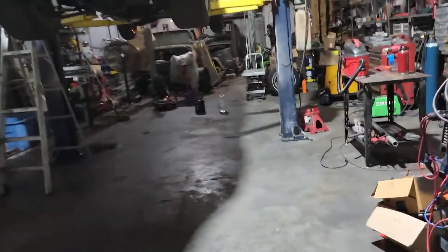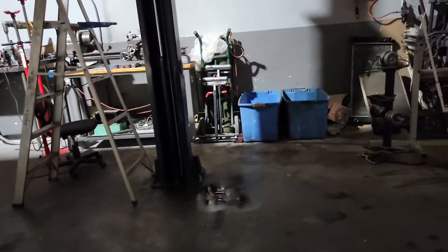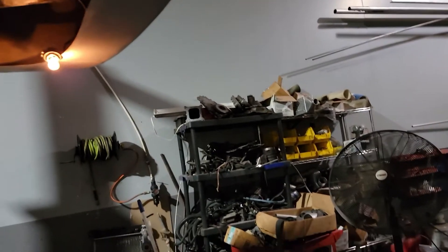Jeff's truck is pretty much done. I've had the radiator draining — it's empty now — so I just have to add the water back in. Oh yeah, that's the side marker light. This bulb goes all the way up to the fender — I'll leave it hanging down. That one's not on because either the socket or the bulb is bad. I think the bulb is bad because if I switch the bulbs, this one will light up.